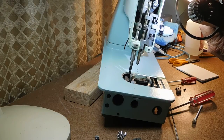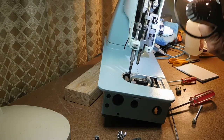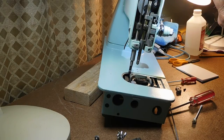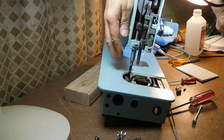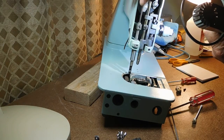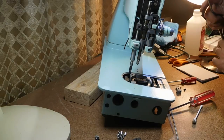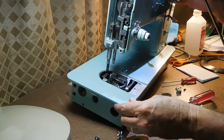I'm going to take the needle holder off. There's one screw that holds the little thread guide pigtail and the needle clamp. There's the shiny metal screw head, then you can take the thumb screw out. Some of these have a little jib in the needle bar that's very small — you've got to watch out for that. They're hard to find and hard to replace, so if there was one it would pop out right now. You can see some of the varnishing and discoloration here — this one is not too bad. I'll clean everything with crud cutter and I'll know later if I need to take it apart for adjustments.